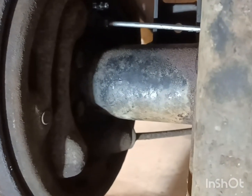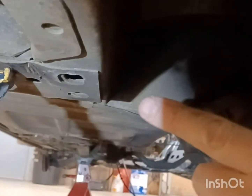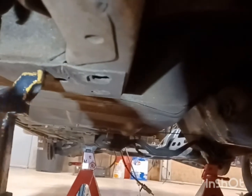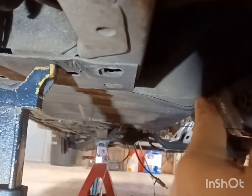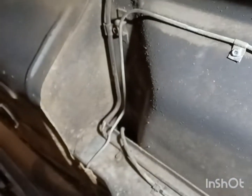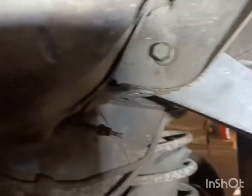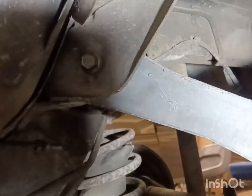If you see where the emergency brake cable goes on a Fox body — they go in through here sideways, through the frame rail, go up and through this way, then hit little curved things and go up the middle for the handle. Here is the 5.0 brake — I had to make some holes, put self-tappers in. I could have riveted it just like the factory but self-tappers work great. It literally fit like a glove. I even used the Fox body little retainer that goes under the frame rail. These are actually the control arms from the convertible — real simple.